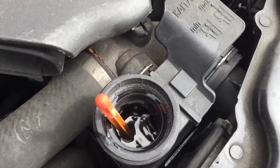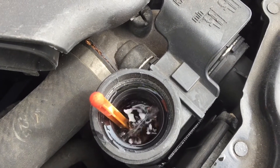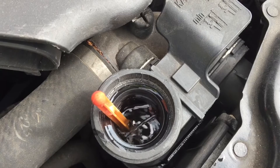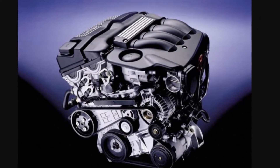This one did overheat, so let's have a quick look in the header tank and make sure there are no great bubbles coming through. Everything seems fine — the head gasket looks nice. And there's the picture of the engine again; you can see the belt on the front and how it's fed around.